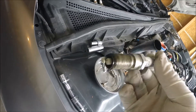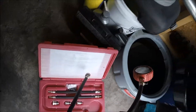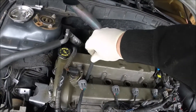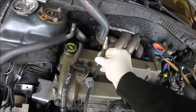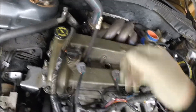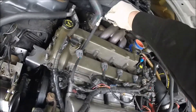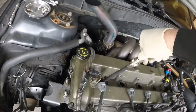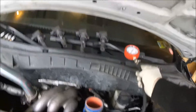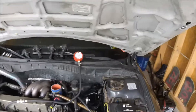As you can see, they're all really white on the tip — I'm pretty sure that means it's running lean. Now we'll get our compression tester. You have to find the right attachment for your spark plug holes, which happens to be this one. Thread it in — don't go crazy tight, just finger tight so you can still get it out. Then connect the quick-connect fitting to the gauge just like an air compressor. I'm here by myself so I'll keep cranking and watch the gauge.